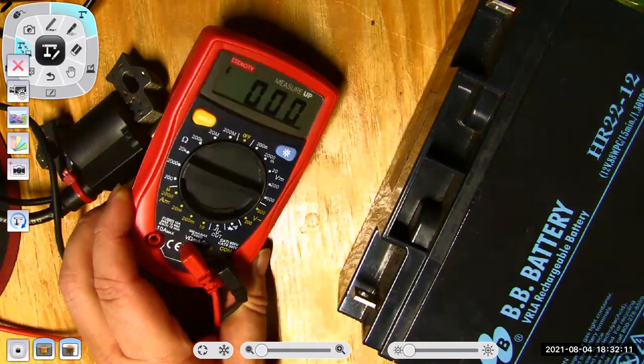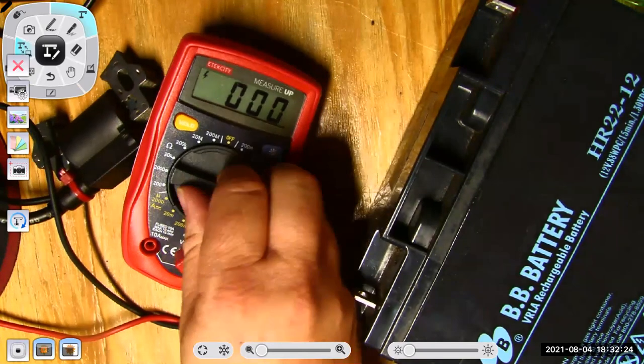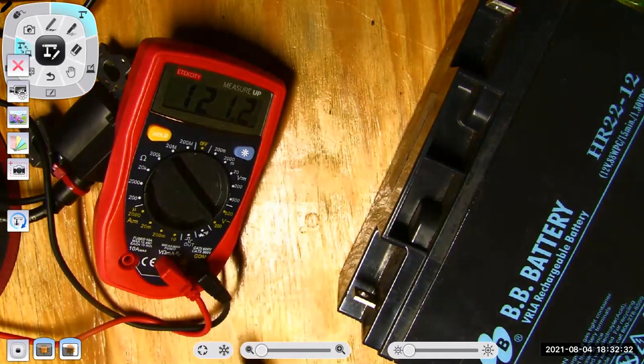So again, if you had this meter set wrong and you're doing electrical work on your house and you measure the voltage and he's set right here, you think, oh, okay, the circuit breaker's turned off. I'm cool. I'm ready to work on it. And boom, you're not, because you really have 120 volts there. So when you're getting into electrical work, you really have to pay attention to how you have your meter set up. And do you really know how to use that thing? Because you're relying on this for your test results. And sometimes you're relying on this meter for your own personal safety. So you really, really have to pay close attention to what you're doing and feel confident with that meter.